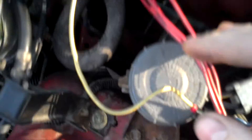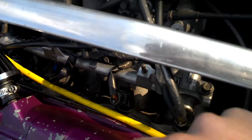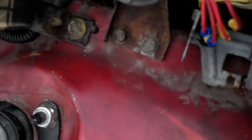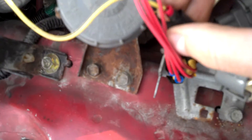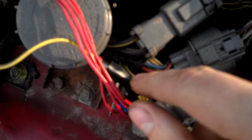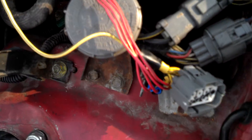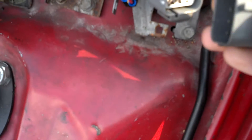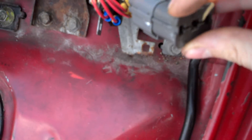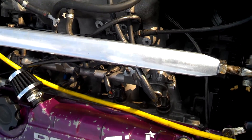Once you test it, these red wires will be going to the injectors, which determines low impedance. After that you connect it — you want to take all these wires and fuse them together, having it run to the one yellow wire to the low impedance module. It doesn't matter what order. After you're completed with the project, you just install this little cap back on. And that's it — that's how you install a low impedance module. Thank you very much.